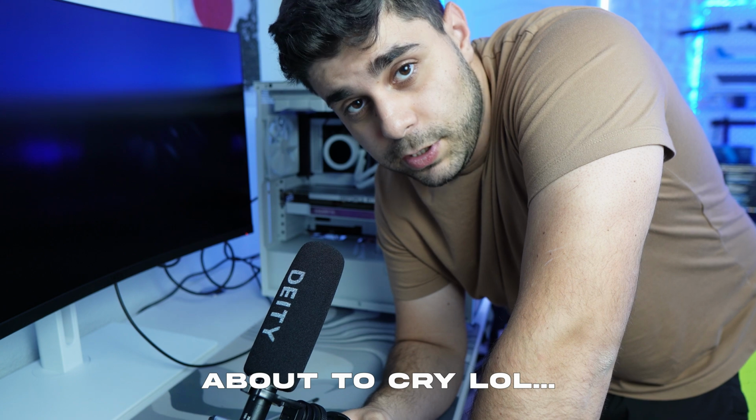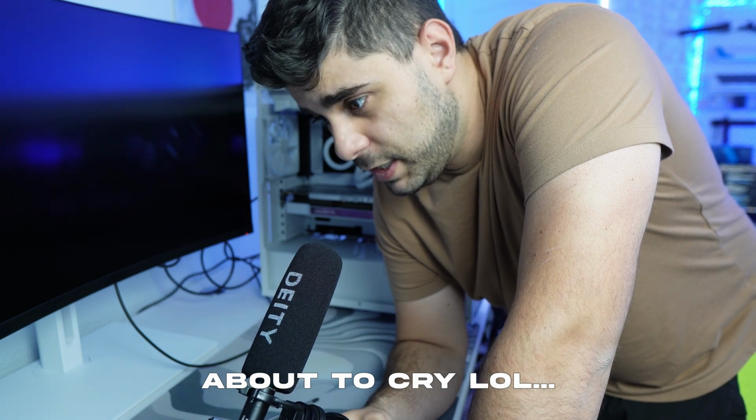Alright boys, it's an hour later. I've tested every single RAM slot combination, cleared CMOS. Nothing is working. So next I'm going to reseat the CPU, see if somehow that got messed up. Reseating the CPU did not work at all.